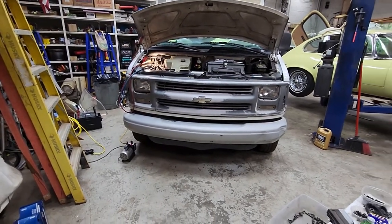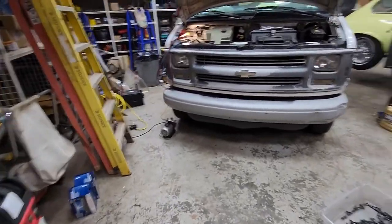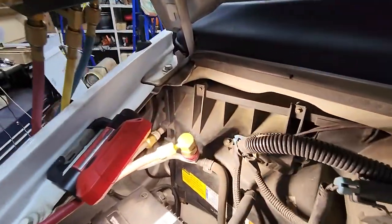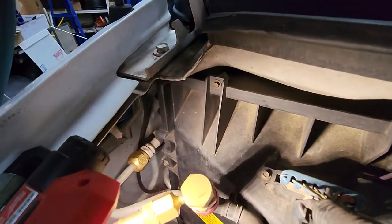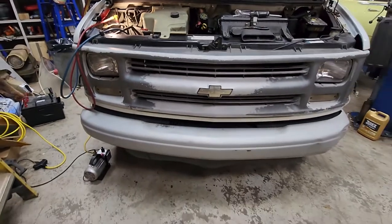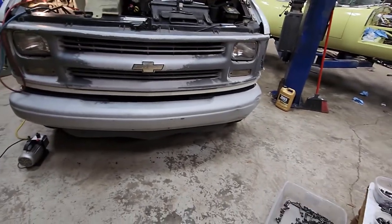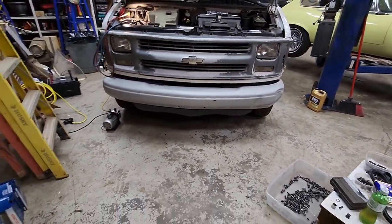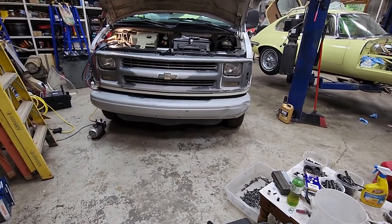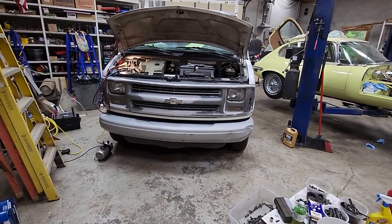This system has been down about 10 years. We replaced the orifice tube - it was very nasty - and had to find it. I'm going to do a separate little short video because it was over here in that tube right back there. I couldn't find it online - I was misled and ended up taking the grill out because everybody said it was down there at the bottom, but it wasn't.